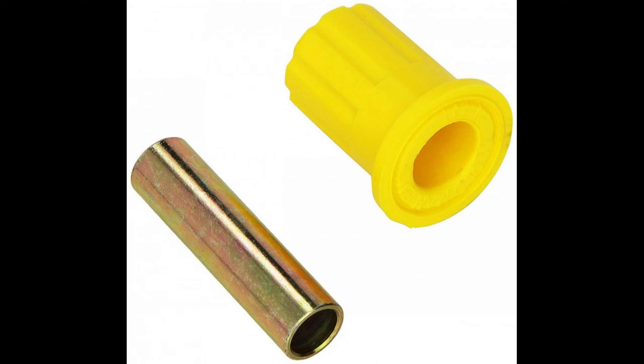Basically, all you do is put the new leaf springs in and make sure the arrow and the plus sign are facing the front — though it might be different if you have a different leaf spring pack. The bushings also needed to be greased. I used moly grease, which is a lithium grease with a molybdenum base. We greased the face of the bushing, the inside, and all contact areas that are going to pivot.